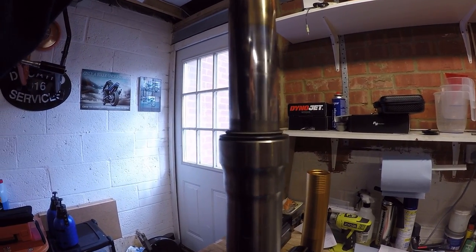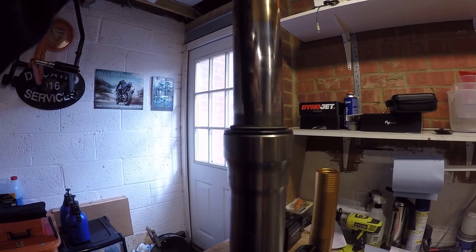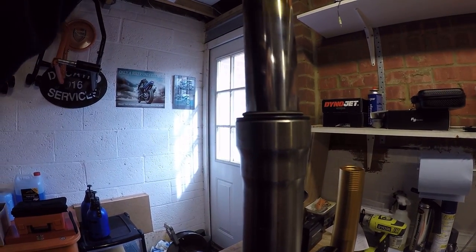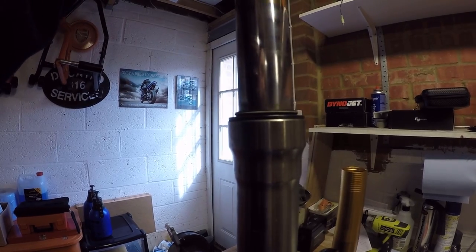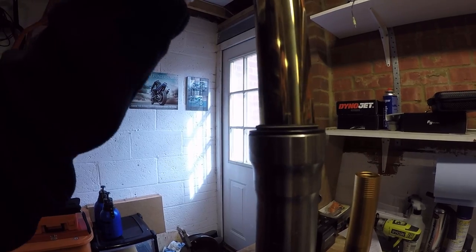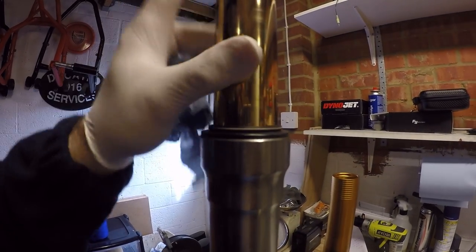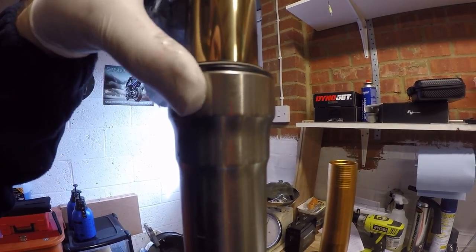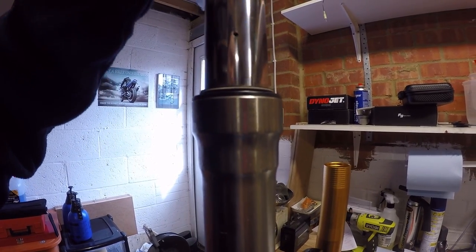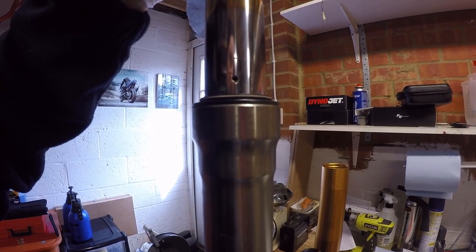What you'll see is when it gets to there, it stops. Hear that metallic sort of click? That's because there's a bushing on the top of the inner stanchion, this piece, and it's hitting against one that sits in the leg as well. All right, so what we've got to give is just a firm tug and that will come out. So let me do that.